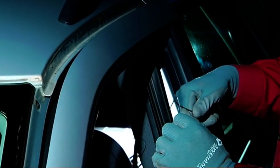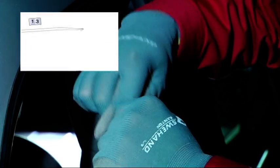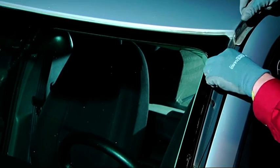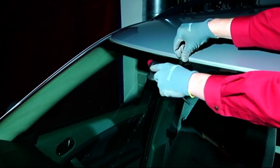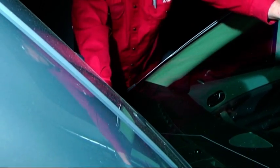Release the insertion tool. Straighten or cut off the hooked end so that they don't get stuck in the clothing or interior. Put the cutting wire around the glass, working counter-clockwise. Make sure the wire gets under all four corners of the glass. On glasses with molding, tuck down the wire between the body and the molding with the roll-and-press method.